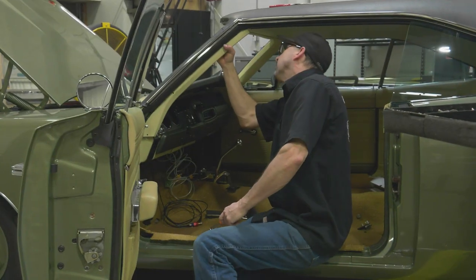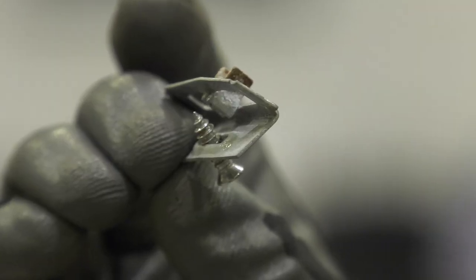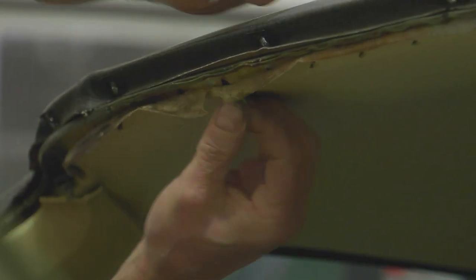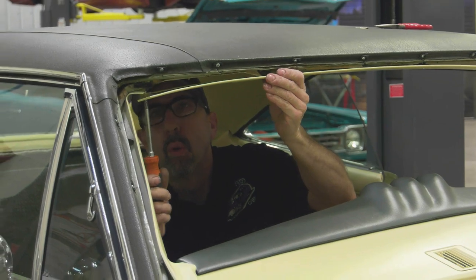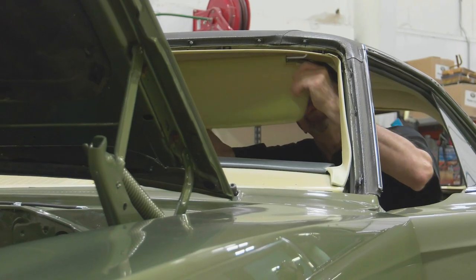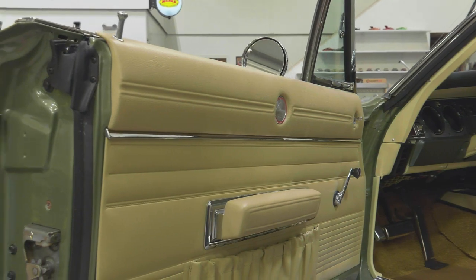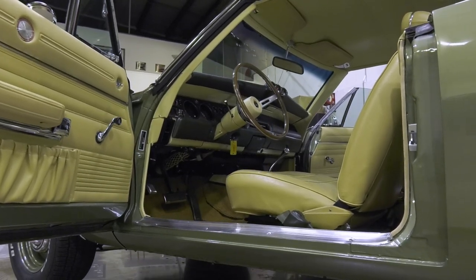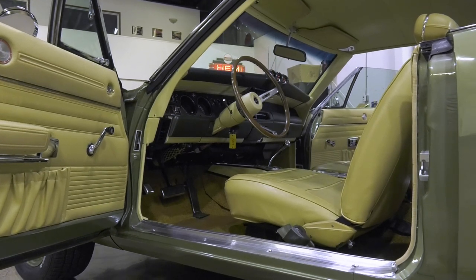Then I can do all my A-pillar moldings, upper windshield reveal moldings, and side reveal moldings. When I went to put in the upper reveal molding on the windshield, I noticed they had actually removed the clips from the front part of the header where the reveal molding mounts. I had to cut back the headliner just a little bit to expose the holes where these clips go, then put those unique clips back in place and get the upper reveal molding reinstalled. Now with those clips installed and the dashboard in, we can go ahead and do the seats, sill plates, and final kick panel. It's right there — really close, almost ready for the road.